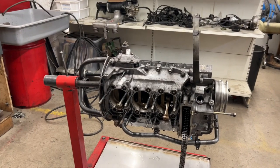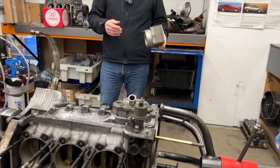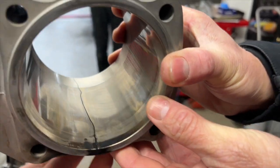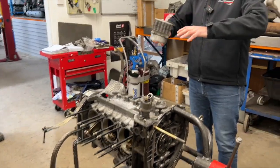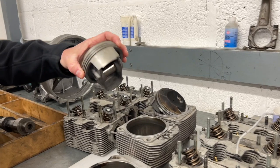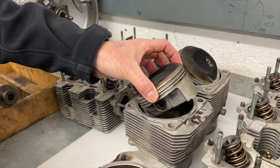Customer with an obvious oil leak and compression issue, 964. We're not completely privy to the history of it, but this is a car that has come to us. Oh my Lord, that shouldn't be there. That has opened that cylinder completely. It looks like, by the inlet manifold, that it suffered a massive backfire, because the inlet manifold was bulged. It's actually split a cylinder, and it's even crushed the piston so that it was trapping the lower ring across where the gudgeon pin is. Customers have been informed of the damage, and we're going to make the right decision to get that back together for him.